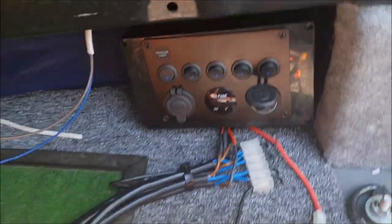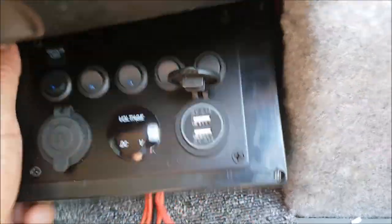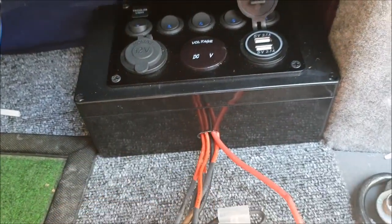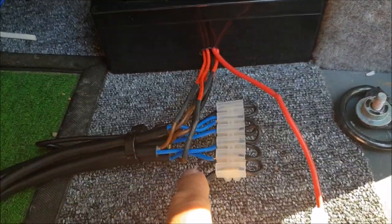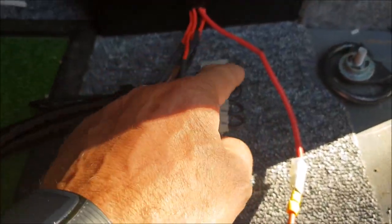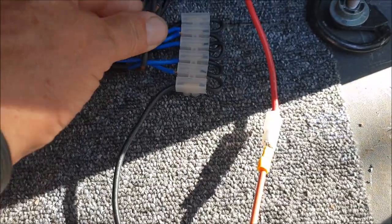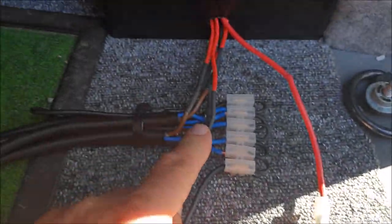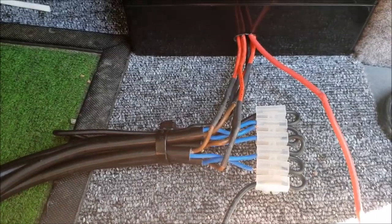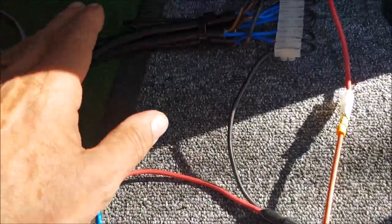What I've done as well, because this has been fitted underneath the seat here, there isn't much room for the original cables that come out — the red ones, and there's one black. So the black goes to a block connector and then it's looped red to each one, and then all the negatives go to that. All the reds I've changed — I've put an extension cable on, they're now brown. You can see that, and they are here, and all there for is easy access.